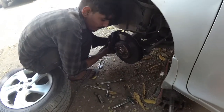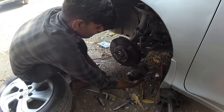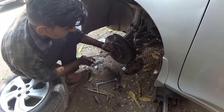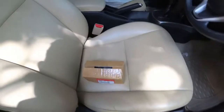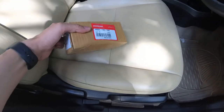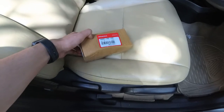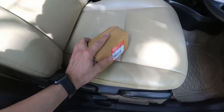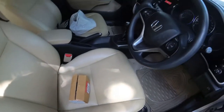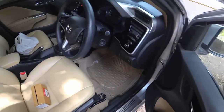Mahir confirmed it. Mahir has been working here for 5-6 years and he told me it has been done. He suggested that since there are lines in the disc, it will not be good for braking performance if we just change the pads. So he has sent the disc for skimming — both discs for Rs 400. Now let's go on with the process. I am waiting for the disc and then we will install the new disc pads.